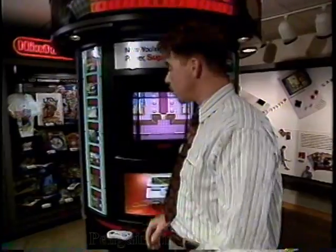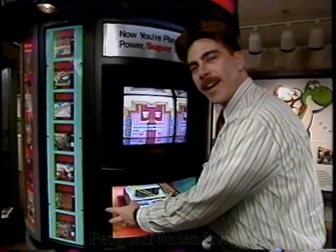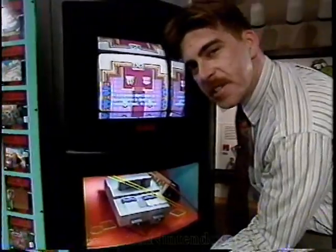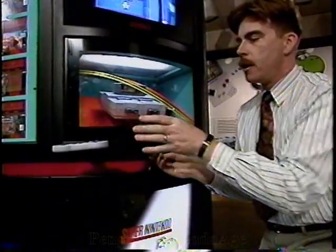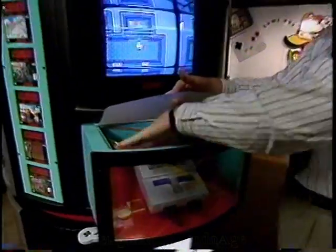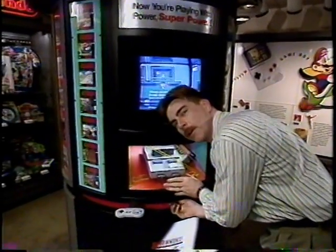Okay, with this thing, all 3 sides are set up pretty much the same. They've got the unit housed inside of a drawer where you can get into and change the game packs out. Let's see how we do that. Underneath the center of the drawer, you take your MM101 key into the lock, you turn the lock, and then pull your drawer out as such. Lift your cover up, you can get inside, change the game pack out, turn the unit on and off. Be sure to close the cover up, and obviously we want to close and lock the drawer down here.